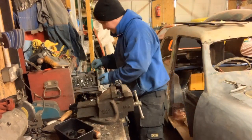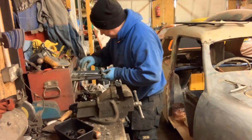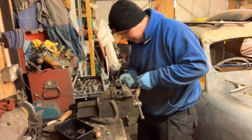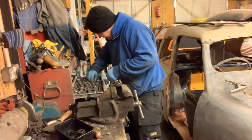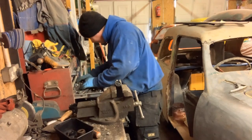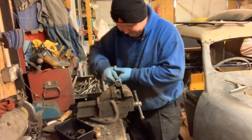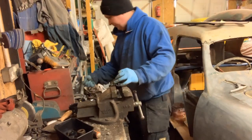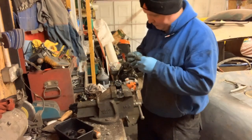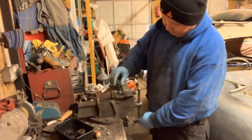When I say little, it's tiny. Let's see if I can find a spanner that actually fits it. There's nothing small enough. This is an 8 - that doesn't fit. Here's a little spanner - this is a quarter. So it's quarter inch. Bleed nipple's out - tiny little thing. Now I'm not worried about turning it round to do the repair work, because I know I'm not going to break that bleed nipple off.